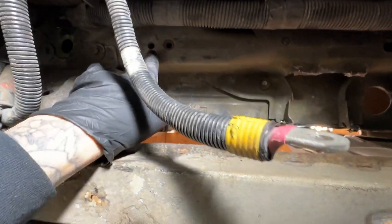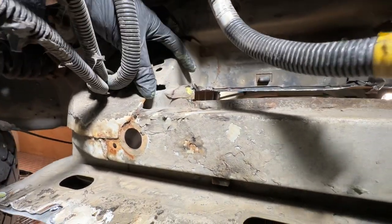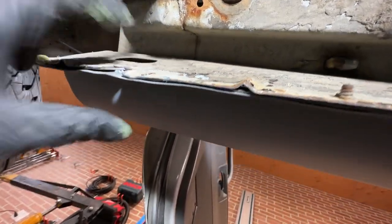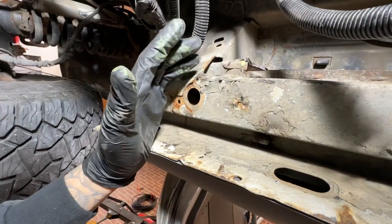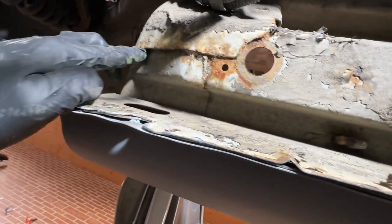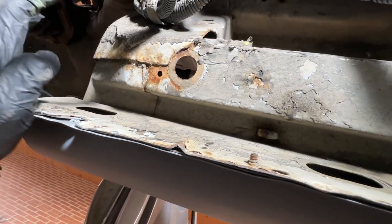Taking a look from down here, I can put these things in all of these holes all the way through there, fill in all of these cavities here with that stuff. And down here I can get in there, fill this whole bottom rocker with this stuff. It'll probably drip out everywhere that's possible, but that's the point - to get it up inside of everything just to keep that rust at bay. The last thing I want to do is see this ambulance rust on me. I've already been through that in my van.